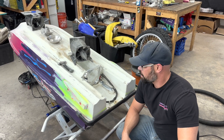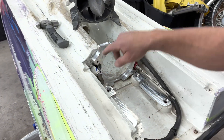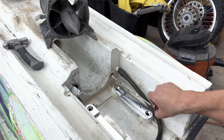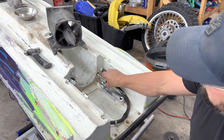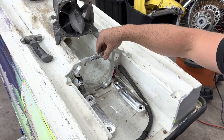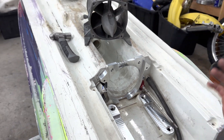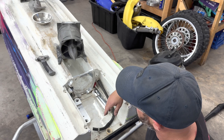That was actually easier than we thought. We went ahead and half mooned this pipe and cut it all the way back against the wall. For the broken steering cable piece, we took an old bow eye from an X2 — turned out to be the same thread pitch — and that fit perfectly behind here. Everything lined up perfectly. There doesn't look like we have to do any modding at all. We cut the hole a little bit there and did the exhaust, but we're going to fill it with 5200. No big deal.